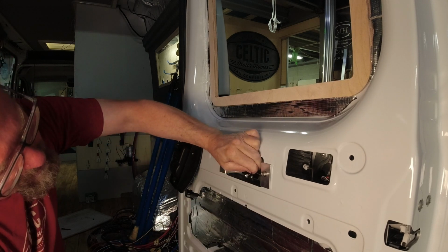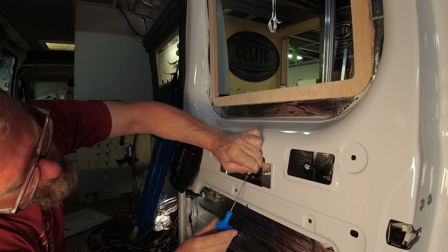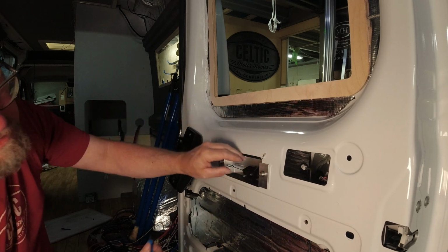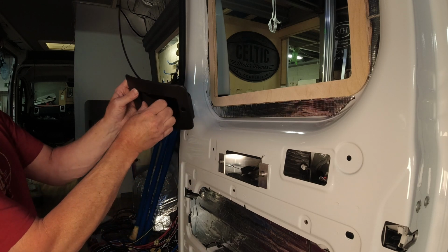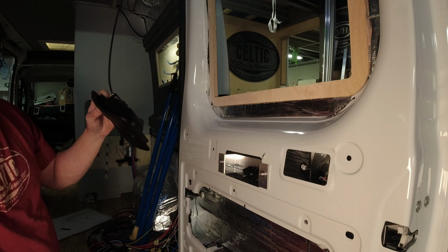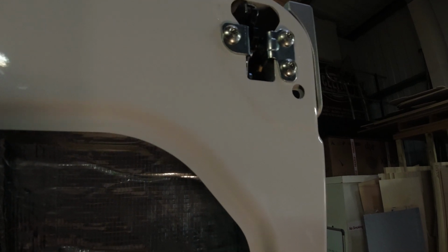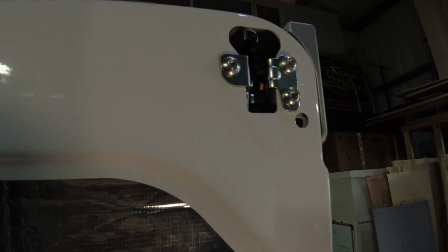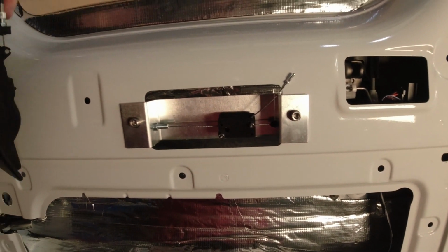Put a little bit of tension on it. You probably don't need pliers, and then just do up the Allen key. Now this one you can nip it up a bit tighter now. So now you should have a working handle. So that's pulling there, and if we look up there, the handle's pulling there. We'll do a quick test by shutting the door, make sure it opens properly. But that's as simple as it is.